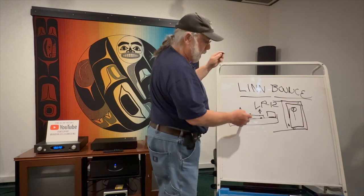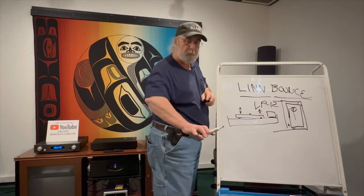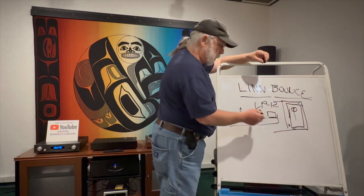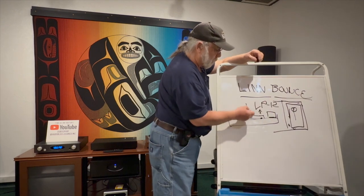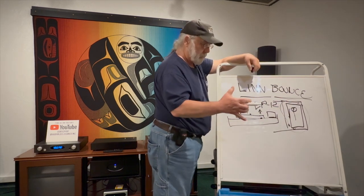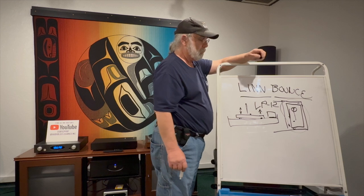A lot of people can get this happening, but when you look at the top, the arm board itself, you'll see that it's doing this. And that again is not proper. You want it to be straight up and down, not only there, but when you look at it from the top, you're assuring that you're getting proper vertical motion. And this is a way of catching it. Because it's really hard to look at the platter, there's a disc, and see that it's actually twisting. The arm board is your key to get there.